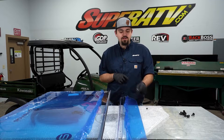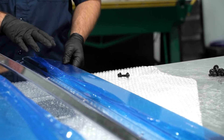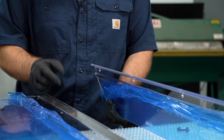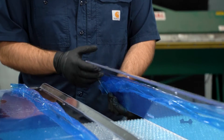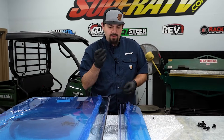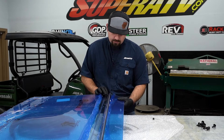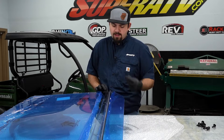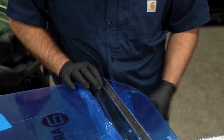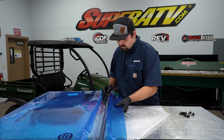Grab the hardware out of the kit — one of the bolts with the sealing washers and one of the nuts. Take the upper portion and orient it with the bin facing down, opposite of this windshield — bin's facing up here, bin's facing down on that one. You'll see holes on both windshields; line those holes up, take your screw, slide it through — just like this, line it up, pop the hardware down through. Go around to the bottom side and get a nut started. Continue working your way down, installing all the hardware.